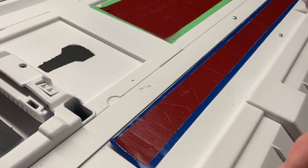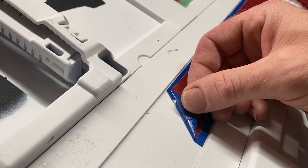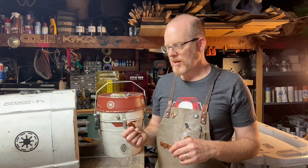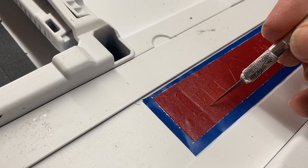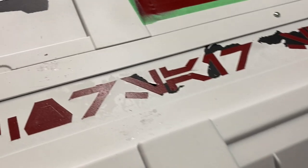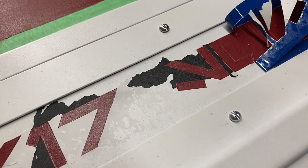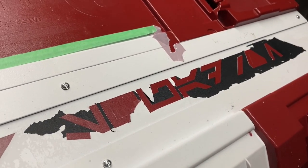If you're starting to pull a stencil and you see it pulling up the paint underneath, stop right there and take a breath — odds are you're going to have a trouble spot. One tedious solution is to cut with a very sharp blade around every spot on that stencil before pulling, so it's not dragging the paint next to the letters. Sometimes that doesn't work either, but it can help. If it's only in one corner, cut it with a blade and your clear coat will help re-bond it. If that's happening, be prepared to peel it off, paint it over, or put a cover plate.